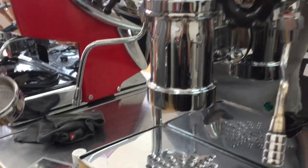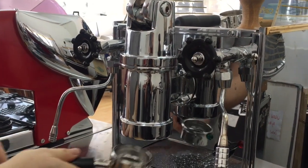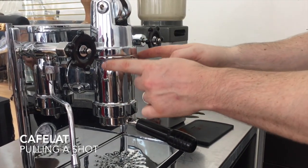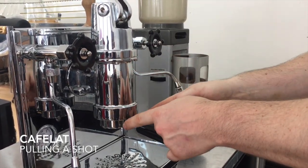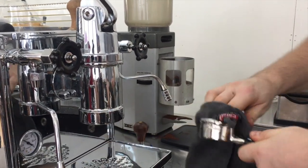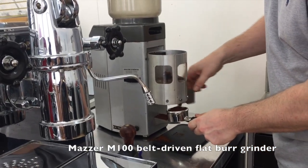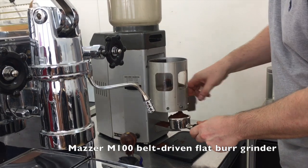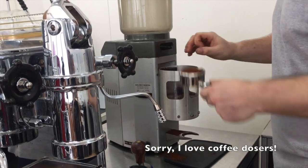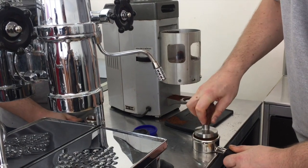You can see the flow — it's actually in. So now we've got brand new piston rings, brand new gasket, and a clean screen. We'll pull a shot just to make sure everything's working. Quite old-fashioned, but we like dosers because they de-clump everything.